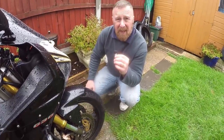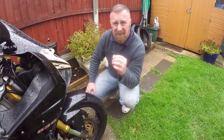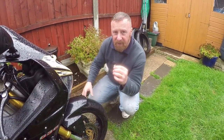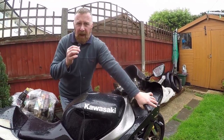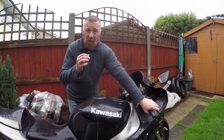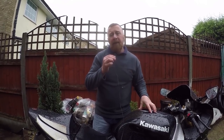The floor is a big one — the first heavy rain you're going to have oils that haven't come up for many months all rising to the surface, getting very slippy. Not only that but diesel that might have been spilt on the road — really slippy. So when you're putting the front brake on, be a little more careful with it. Don't pull or snatch it, because the front will go. Your style of riding and your tires need looking at before you even address the bike.